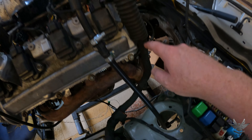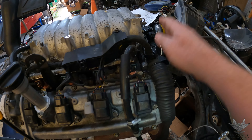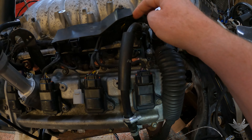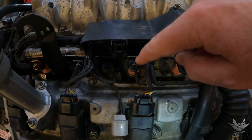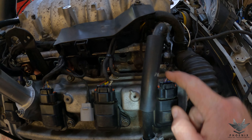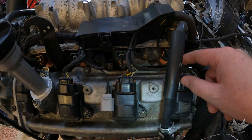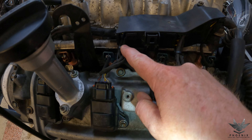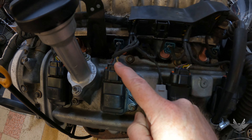That's going to run up the back of the engine and split into two sections. The first section runs down the front. Coming down here, we've got injector 7 popping out over there. Coming over here we've got injector 5 and coil 5, and also coil number 7. That obviously is the long one, so that one won't reach there — you shouldn't be able to mix it up, but just remember that. Coming along to the front of the box, we've got a breakout going to injector 3 and coil 3.